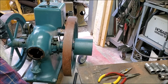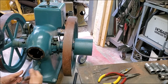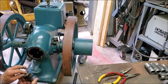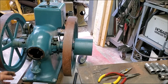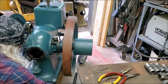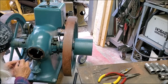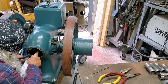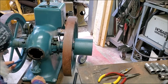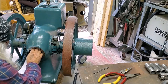You have to put these two back in there to secure the two big ones. When you put that on there, that's what holds the bearing from spinning around. We'll have to put them back in there. It is marked right there with a dot — and that's the top. I thought there were more shims in the bottom than what's showing up. We've got another shim down there on that bottom. No, that's the rod right there — there ain't no shim on that. And we're good up on the top, too.